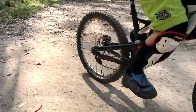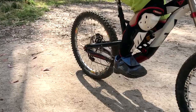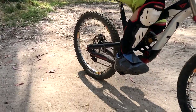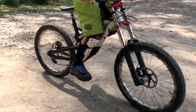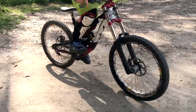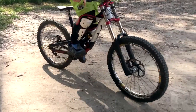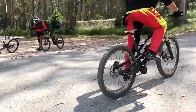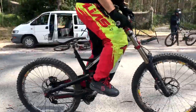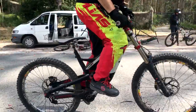Here is what actually happens in reality — this is me on the bike accelerating. If you look closely, when I pedal, the rear suspension extends and the bike lifts. Look at the saddle — it lifts. This is another example: again the rear suspension extends, the saddle lifts, and the fork also lifts because of the weight transferring backwards. Here is my friend pedaling on his bike and you can see exactly the same thing — during the pedal stroke, the bike lifts and the rear suspension extends.